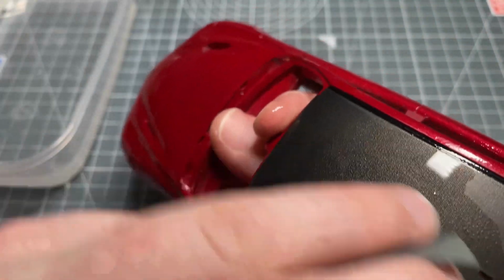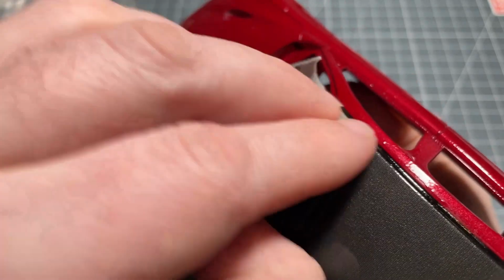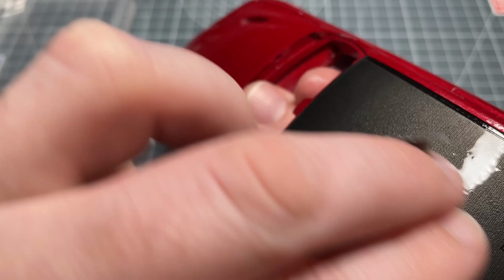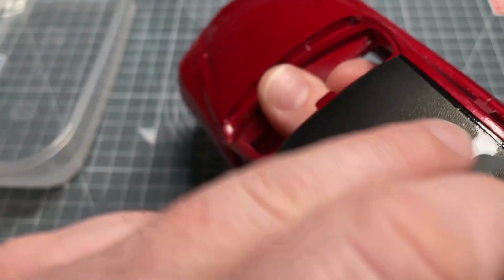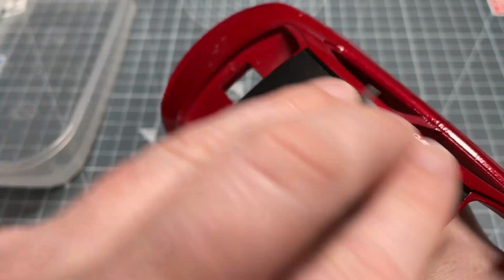As I said in the previous stage, only you will know how much clear coat is down, to know how far you want to take it and what the risk level is for cutting through. So you want to get the orange peel out completely if you can. The low spots on it are still clear coat, so they'll give you an idea as to how thick or thin the layer is, so you need to keep that in mind when you're going through these stages. That's partly why I stopped where I did, because I know there are further grits coming that will take it back further, so I'm not overly fussed that there's still a little bit there, because the 6000 will get rid of a lot more of that.